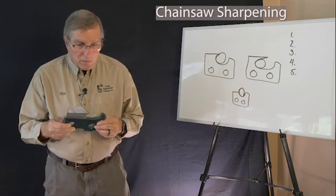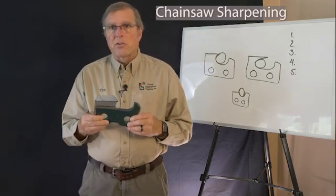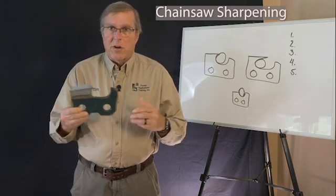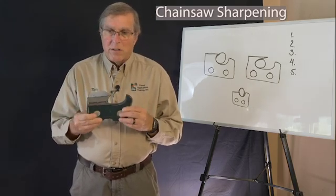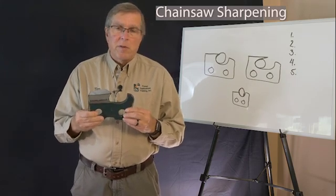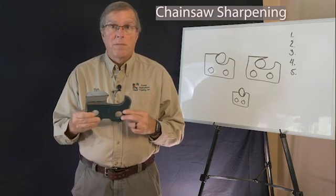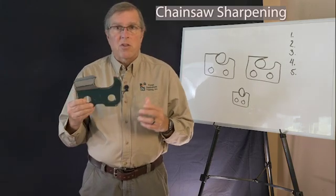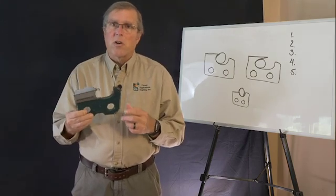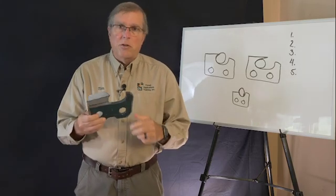You know, I think probably 70% of the people that I talk to that have been injured with a saw, whether it was a cut, laceration, whatever happened, loss of control, when I go back and start to discuss with them and look at the situation, the chainsaw chain was dull. And what do you have to do if you have a dull saw chain? I know you need to sharpen it, but actually you have to work harder. You have to apply more pressure. You have to push and pull on the chainsaw.